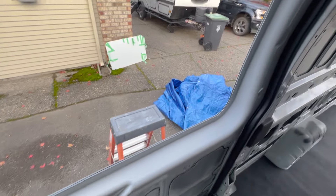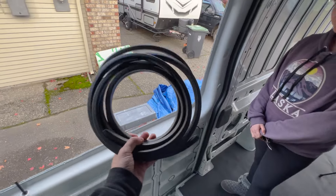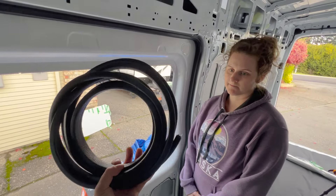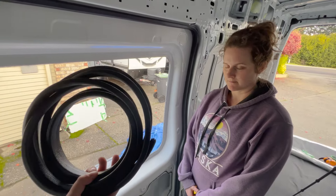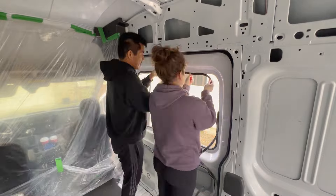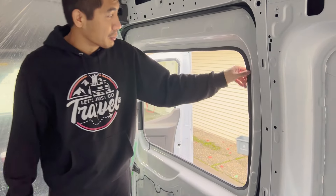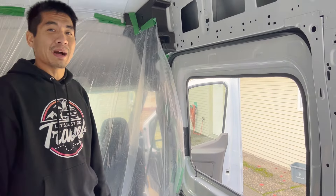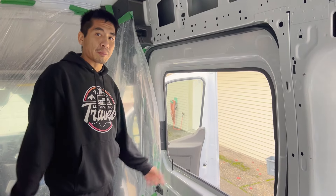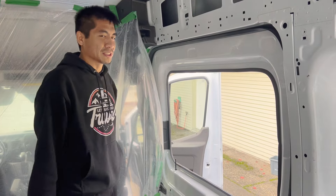The paint and primer have dried on the edge of everywhere we've cut. It's starting to get cold now. We're going to go ahead and put this trim on the edge of this metal — it's basically just take a rubber mallet and hammer it in, then cut off the end and match them up. We have finished hammering in this interior trim piece for the window — it actually looks really nice and definitely hides my crap jigsawing. We're getting close to the end now. We're going to step outside, prep the surface, get the glue on, and do a test fit first.